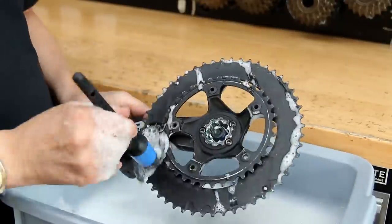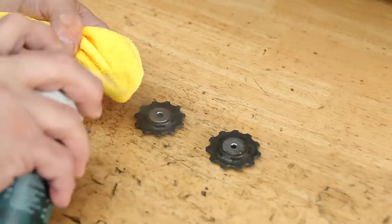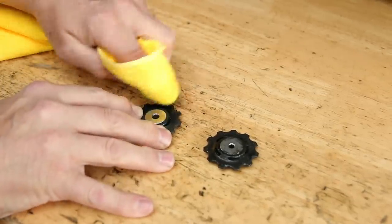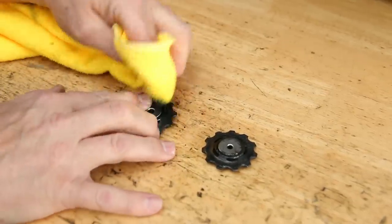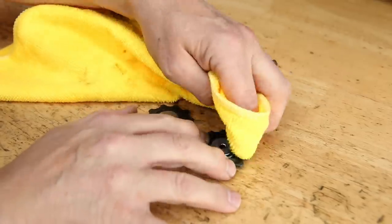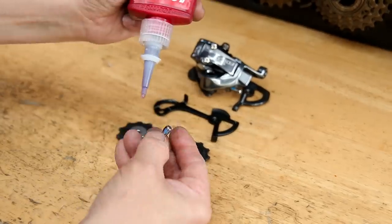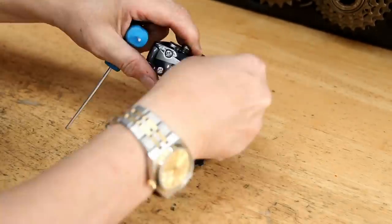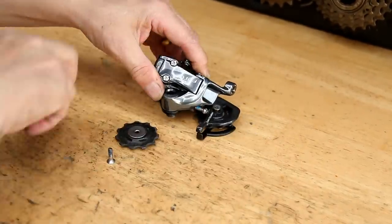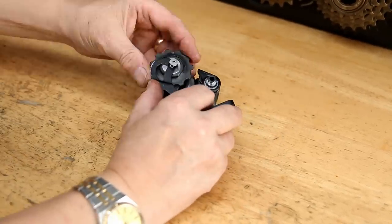The chainset I didn't put in the ultrasonic cleaner — just doing that with warm soapy water and our detailing brush, a nice nylon bristle brush perfect for this kind of work. For the jockey wheels, I'm just using a little bit of cleaner on a rag to clean them off. They have bearings inside, so I wanted to make sure they were clean without disturbing the oil and grease inside those bearings.